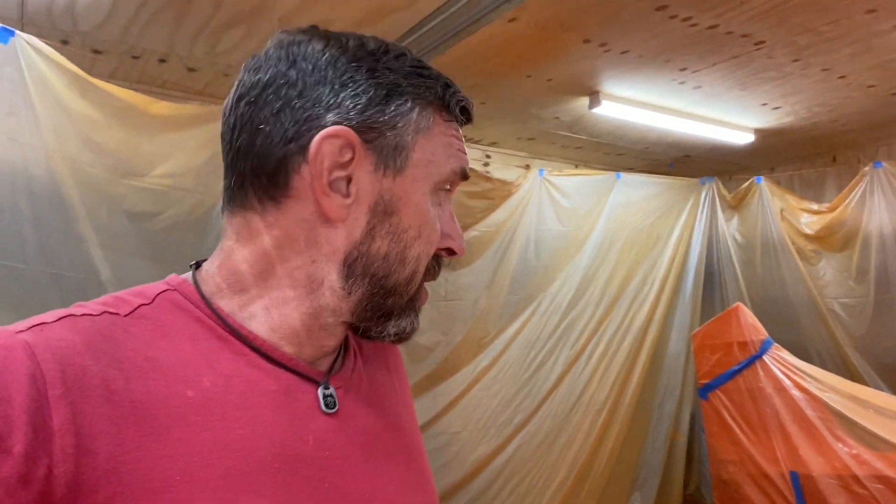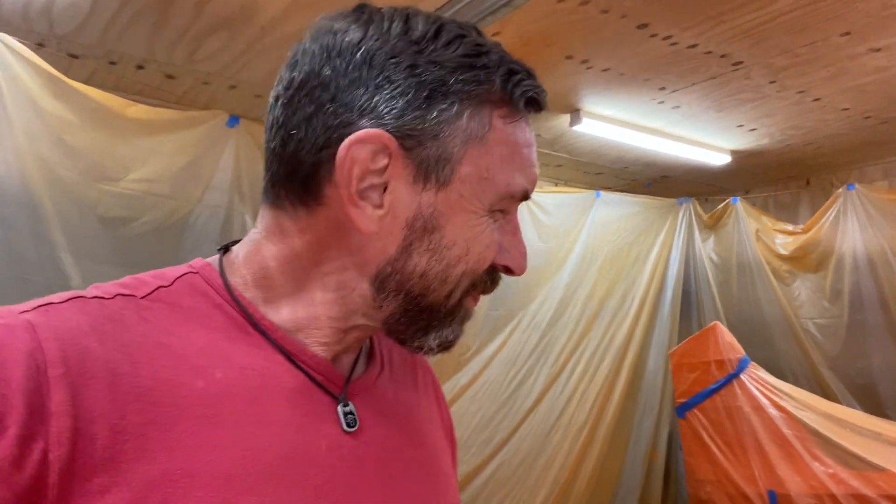I still have the inspection port covers for the rear fuselage to paint — I'll probably do that in the next day or two in the same batch. But before I do that I've got to drill some holes through them and split a couple so they can be assembled properly. I backed myself into a corner — I match-drilled all the holes without cutting the holes for the elevator tubing. Someone suggested making a template out of clear plastic and I think that's a really good idea.